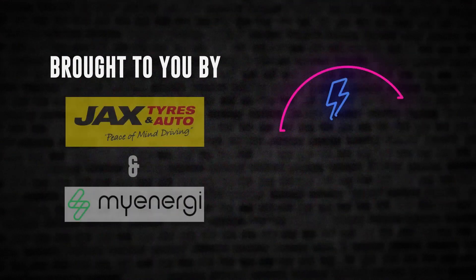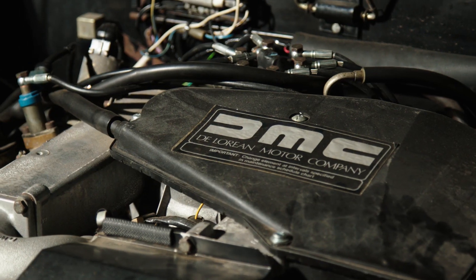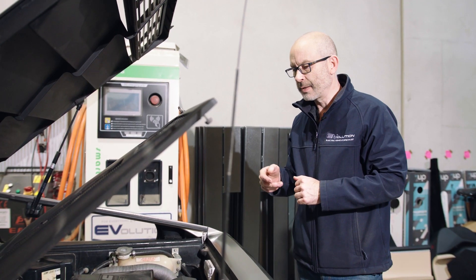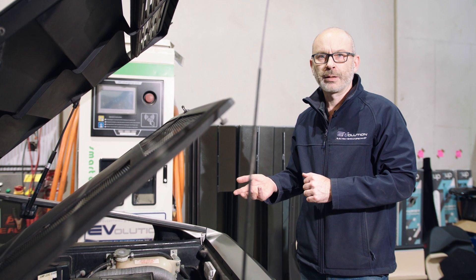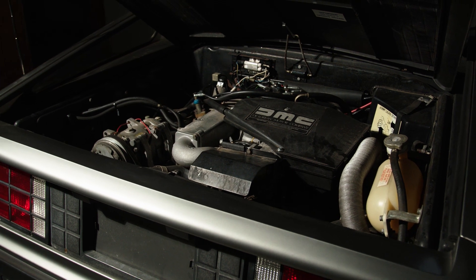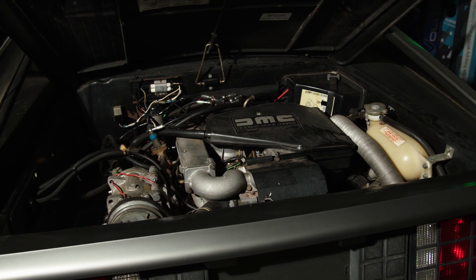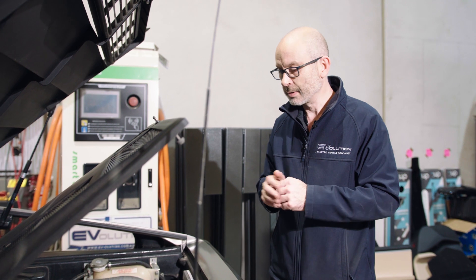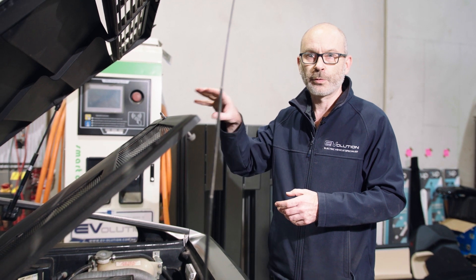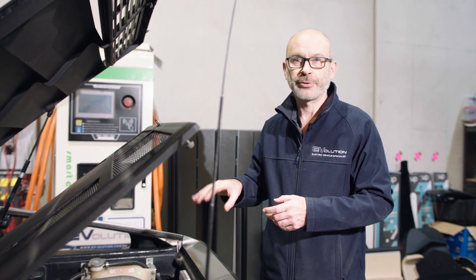Let's have a walk through. Pretty basic motor — asthmatic, some might say. When it was developed in 1982, it was pretty old school even by those standards, developing only about 130 brake horsepower. The Tesla drive unit should fit in here quite nicely. There's obviously a fair amount of modification required to make it fit, but it's nothing we haven't done before on other vehicles. We're looking at putting a total of eight Tesla modules in here — four in the front, four in the rear. The small drive unit will take the power up to about 350 kilowatts.